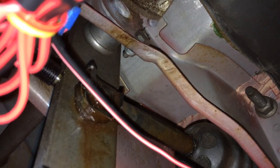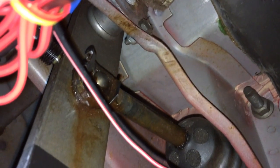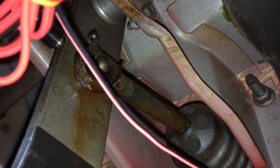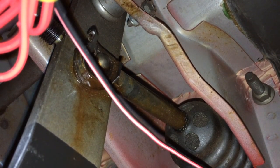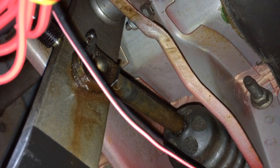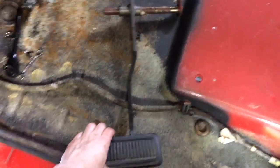I'm gonna go ahead and rip out the brake pedal assembly right now. There's just that screw right there to take out, and then the rod is gonna come out this way, and then of course we have to detach the master cylinder brake rod there. It's as simple as that — just take out that rod and then the brake pedal assembly's out.